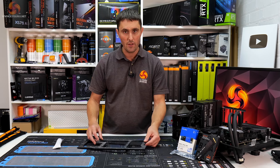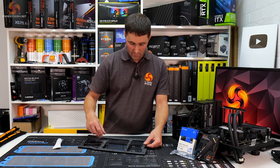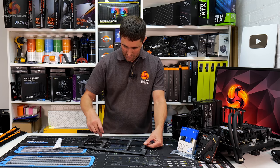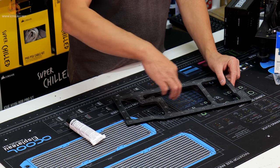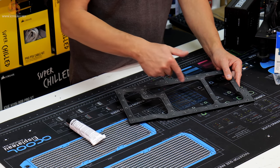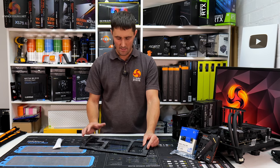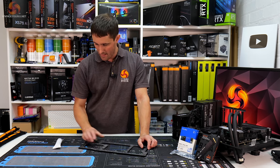there. If you saw the original video, you'd have seen that the water was flowing. You could quite clearly see the water was flowing just from this fitting to the other one in that kind of direction, and there was a lot of stagnant water either side that wasn't moving. So putting a couple of baffles in should help it flow a bit better and not allow any of that stagnant liquid or water to be there in that mid plate.